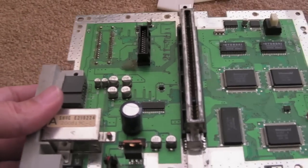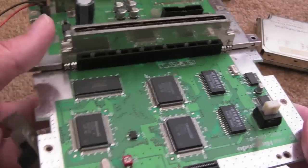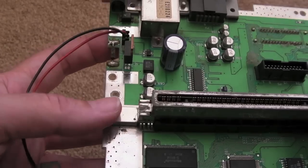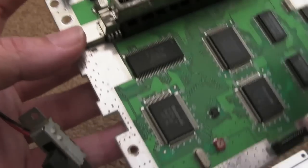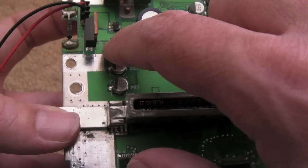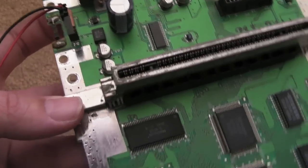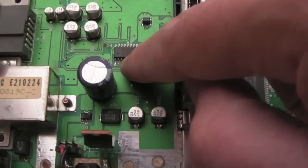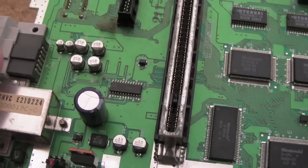You'll probably also get problems with SRAMs at some point. If you get one of these and it's scrubbed faulty with no output or a black screen, investigate the power side of things — those three components there. There's also a VR1 — some sort of beefy diode or something. That looks like a video encoder based on the position with these caps and the output being there — maybe S-ENC encoder. It might even be a PAL/NTSC encoder, possibly configurable by jumpers.